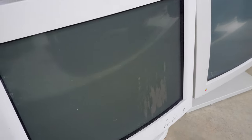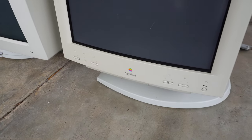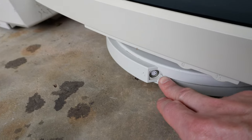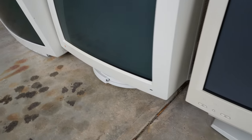There are some bad marks on the front of that tube in the bottom right corner. The monochrome monitor has a fresher phosphor on the side where the image hasn't been beamed, and you can see the inner part is darker. That'll be a Trinitron for sure. There's AppleVision badging, and on the stand you can see what appears to be an S-Video connector — but that's actually Apple's Desktop Bus system, used for plugging in keyboards, mice, and other peripherals. This was before USB; that's how they did it in the old days.